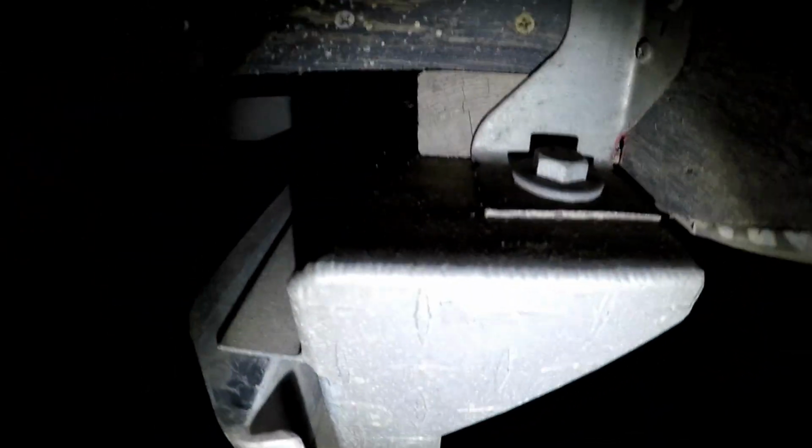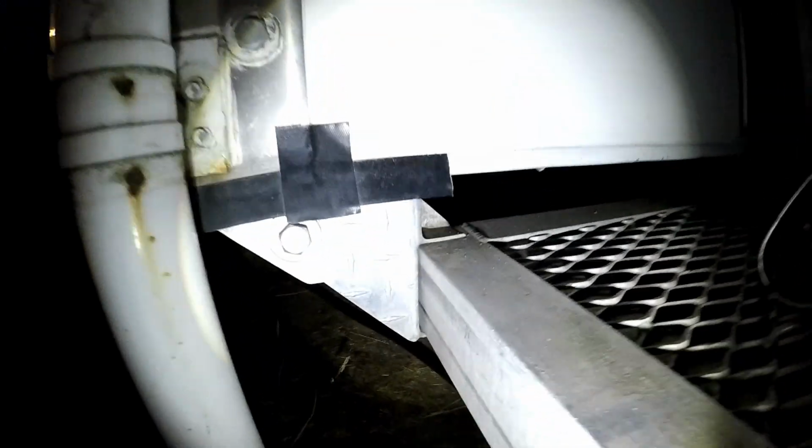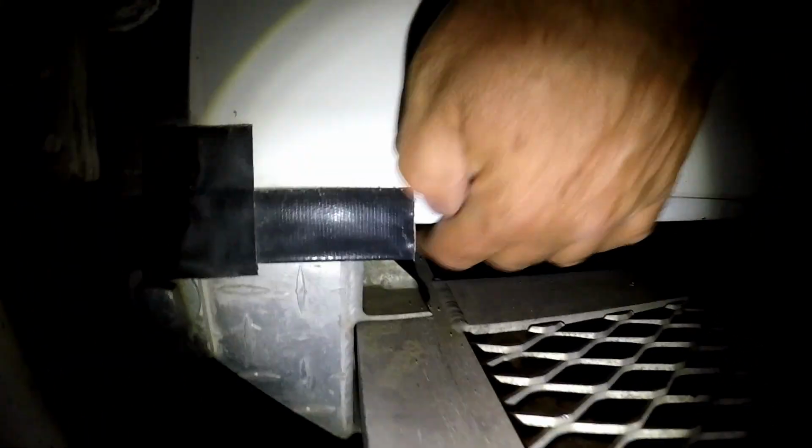And just another look back here. There's that 2x4 block to space the deck down, because it's got that 2x2 framing member across the back of the truck camper. You can see the conduit going across there. So that spaces this down to match that. And then there's about a 2-inch space below the camper itself right through here.